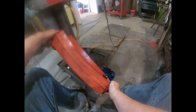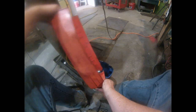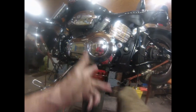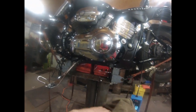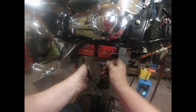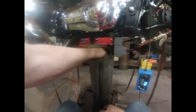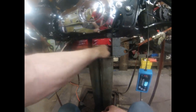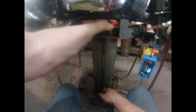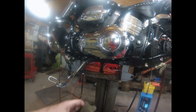So I'm going to put it in here, from the primary, and all the oil will sit on the other side of the crankcase. I'm here by myself, so I'm doing it this way for that reason. I can't tip it over and do all this at the same time. You can just tip it away, and I've done that in the field, especially when you've got like five or six guys standing around watching the world famous field changing out of a stator.